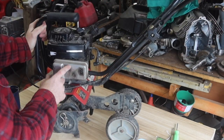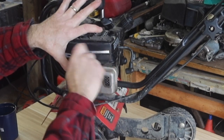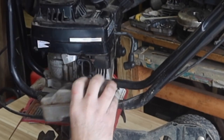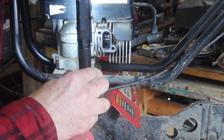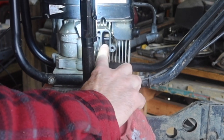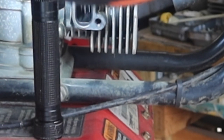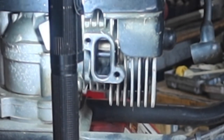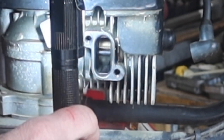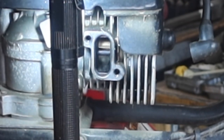One last thing I want to check before we get too far — I want to pull off the muffler and check the rings real fast. If all that's good, we're going to give it a try. Let me get a flashlight so you guys can see too. This is two stroke, so it doesn't have an exhaust valve. When it comes through that second stroke it's actually pushing the exhaust out. You're going to see the piston and the rings coming past. There are the rings right there — see those black things? We're looking for significant scoring like engraved lines going up and down, and I really don't see that. You have to be cautious — is it oil making a line or is it actually a scored mark? This thing might actually be okay.